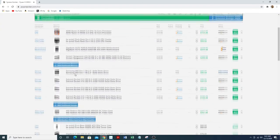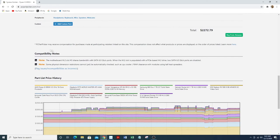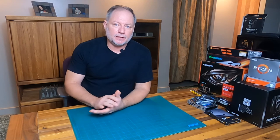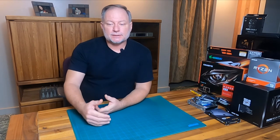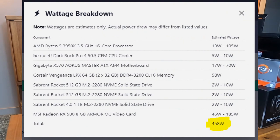On PC Part Picker, you can pick each of the components you need to build your own PC. As you pick each part, it will verify compatibility with the other parts you've already picked. If there are any issues, it will list them at the bottom of your parts list. As you can see here, I have two possible issues with my build: one being that my memory sticks may not fit because of my CPU cooler, and two, that if I use the third slot in my M.2 storage hard drive, I will lose the capacity of using two of my SATA ports. I've done some research on both of those issues and I'm not going to have any problems. It also tells you the total wattage of your system so you can choose the appropriate power supply.